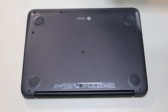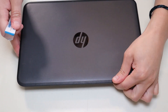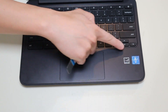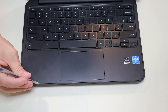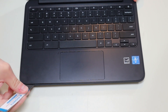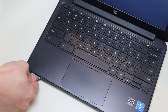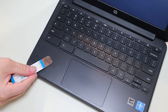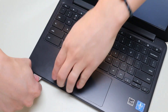After the screws are removed, I'm going to take my small flat pry tool, flip the computer over, and go along the seam between the palm rest and the bottom case. I'm going to pop this palm rest up from the bottom case. This may be a little bit of a process — it is kind of difficult, so just go slow. Don't put the pry tool too far in; you could damage some internal components. Keep it on the edge and firmly pop the palm rest up as you go along.